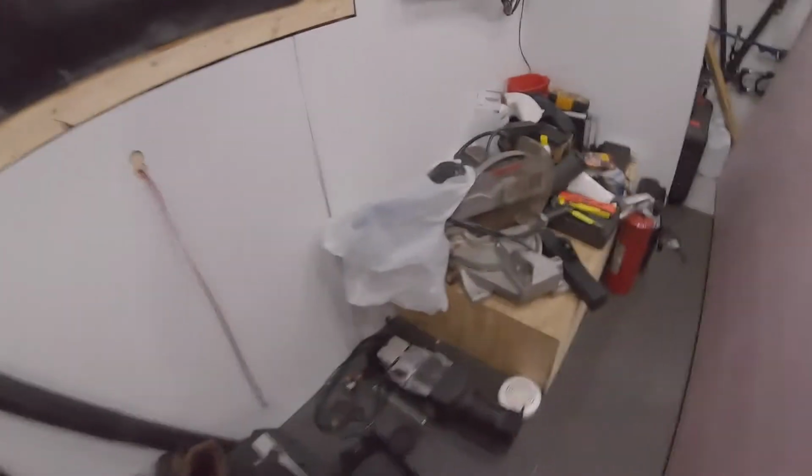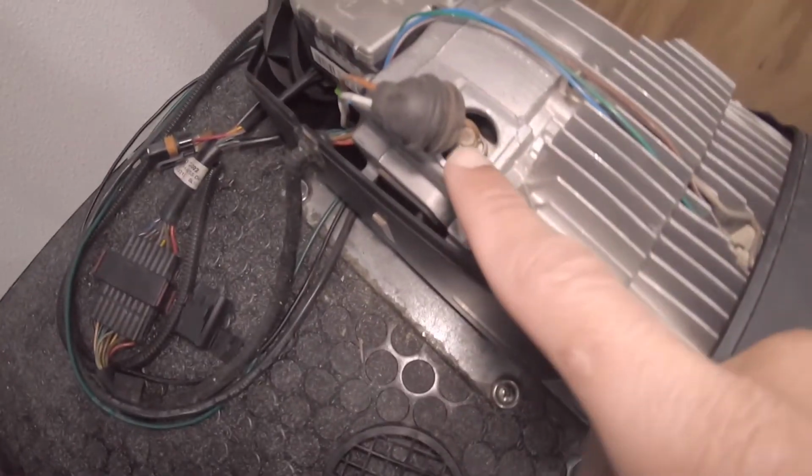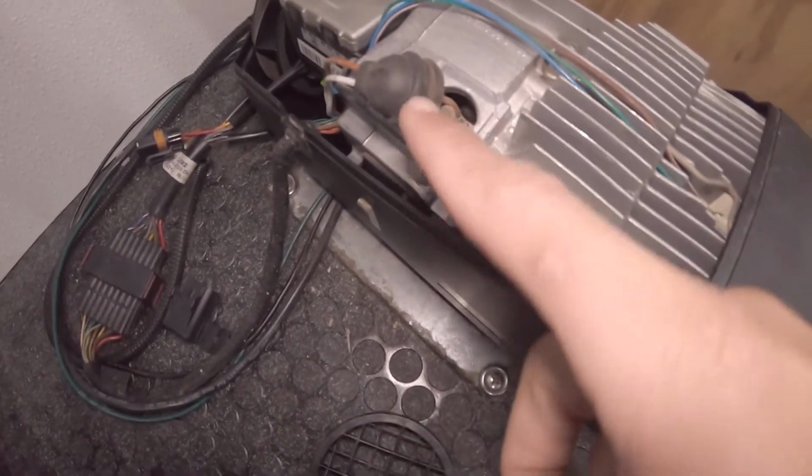This part right in here. I don't know if you can pick that up. I believe it's that part right there, because when I took this cover off, you could smell the diesel. You can hear the pump working, so it's getting fuel. You can smell the fuel, like it's getting air. There's no air blockage. The only thing missing to ignite is the glow pin. So I believe that's caked up with soot, probably from lack of maintenance. I don't know the last time that's been serviced, but we're going to service that today.